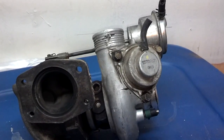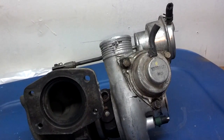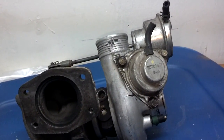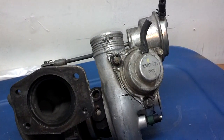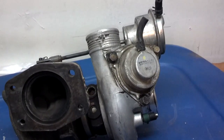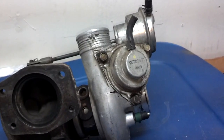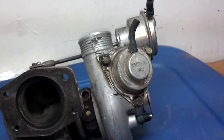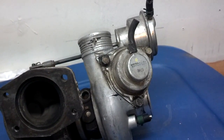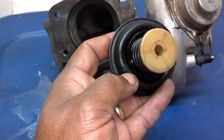You're driving along and you know how much you're supposed to boost in PSI, or how far your needle's supposed to go. Then one day you notice it's not going as far, and that slowly gets worse. Your boost pressure drops from 10 PSI all the way down to 8, then 7, 6, 5 — before you know it you're only boosting 3 or 4 PSI. Chances are you have a torn diaphragm in your bypass valve.